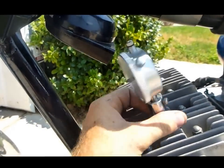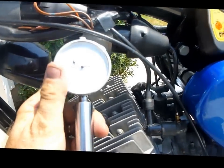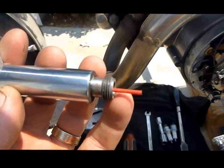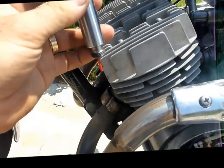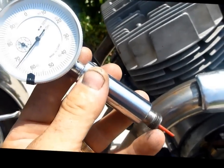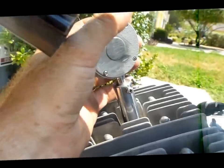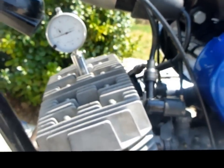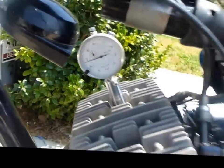So let's do the right cylinder now. I'll take my multimeter over to the right cylinder lead, then unscrew the dial gauge. On this motorcycle I made an extension out of a little spray bottle hose — it's not as solid as metal but it works just as well. I needed it because on the RD350s this tool doesn't quite clear, so I need something a little flexible down there. I'll screw this tool in through the spark plug hole until it's seated, with the screws only medium tight so it can rotate slightly. Let's find top dead center — I take my wrench, the motor rotates counterclockwise, and I'll just turn the motor and wait for the dial gauge to pop up.